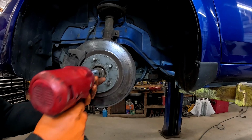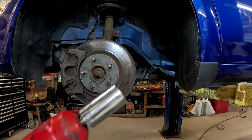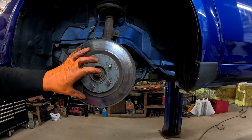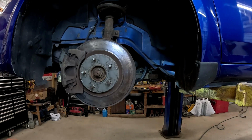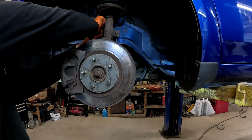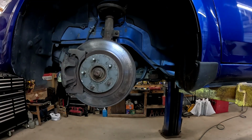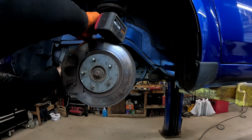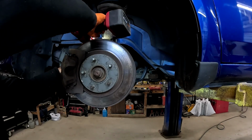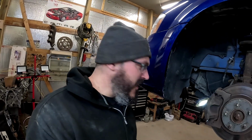All right, go ahead and tighten your axle nut down. And then obviously you're gonna check that for proper torque with a torque wrench. So at least we're getting it seated right now. We're gonna go ahead and put our brake lines back up there. You say we pulled our ABS cord loose. These are both 13, so easy enough. This dude just hooks there. Send her home. And that's it. Don't forget to grease it either, by the way.